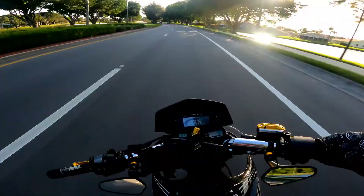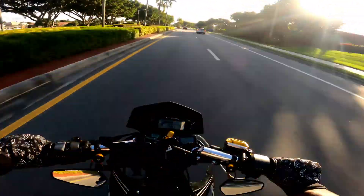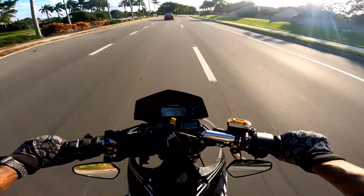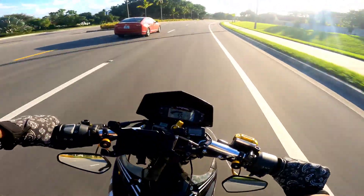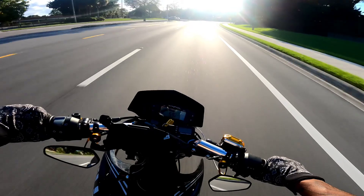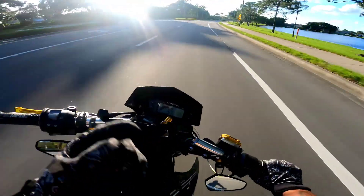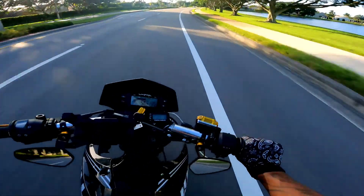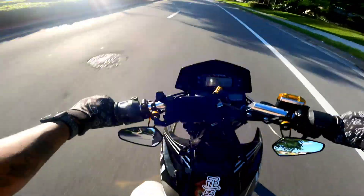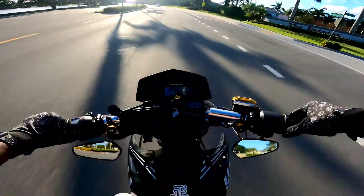Nibby carb was a success! I love when things go how I want. At first I felt defeated because I didn't know what was going on, but too many people have used this carb on their 250 — it had to work for me too. When I took the carb apart I saw the slide with the stock cable wasn't closing 100%, letting too much air in. When I started it with the actual throttle cable off it was fine, so I knew it was the throttle cable.